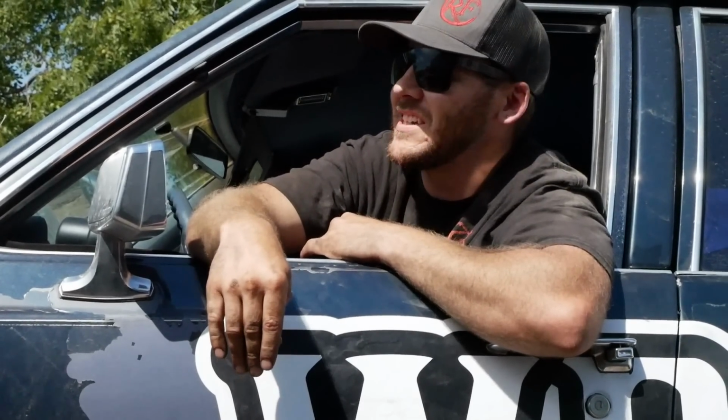Everybody was asking what happened at the truck pull. It was the alternator the entire time. The battery barely started the car right before the truck pull. It just didn't have any power to fire all the cylinders. We got that fixed. Obviously you can tell it's running a lot better now, and you can actually give it some gas and floor it. You gotta get the new Holley 750 put on next week, so watch out for that video.